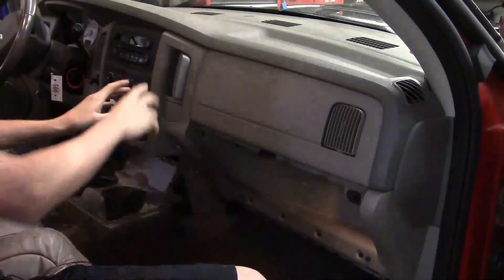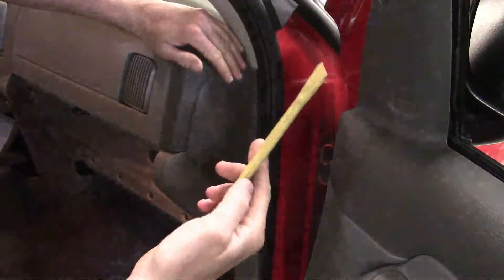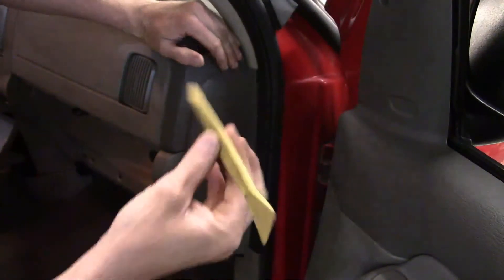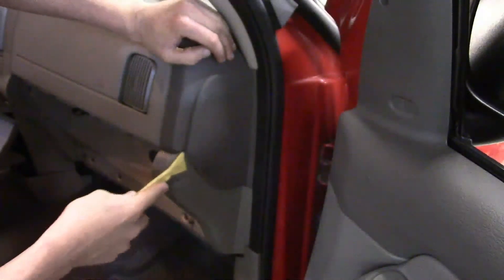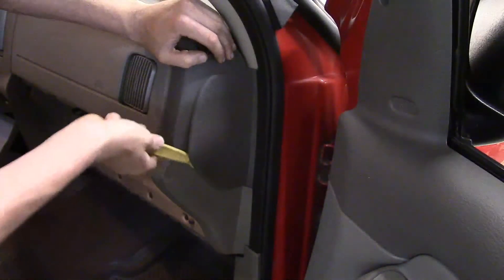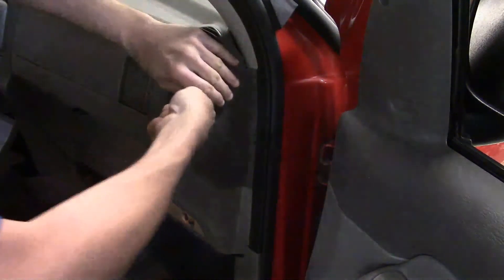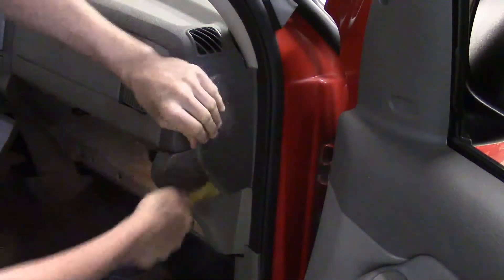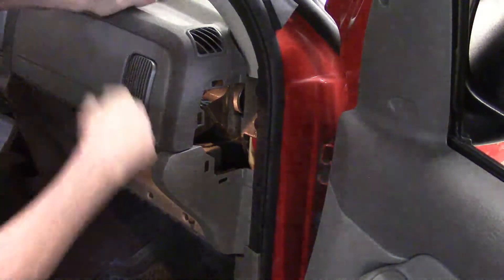So here are the hook-type hinges and these are the two fingers I was telling you about that you need to push down on in order to get it out. Set that to the side, then go ahead and start getting this cover off and work on getting that center dashboard off as well. As always, use a plastic trim stick — that way you don't scratch or mar up the plastic. Anything metal could cause damage. Get up in here to get these snaps loose, find your corner, and start prying.